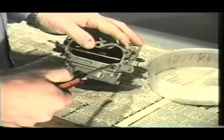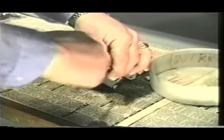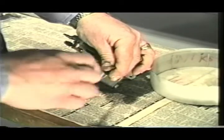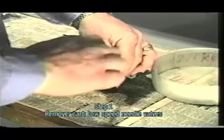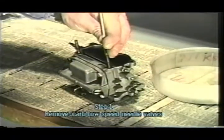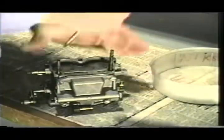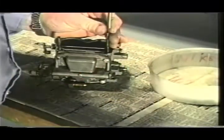Let's start by breaking down our carburetor. We're going to pull out our needle valves. This is the earlier model Type II carburetor — you'll find this a very common carburetor beginning in 1968-69 through the early part of the 1970s. We need to remember, like always, be very careful when working because you're working with brass and aluminum, and they tend to strip very easily. These needle valves are quite long, so just a little bit of patience in getting them out.